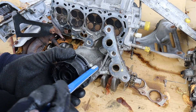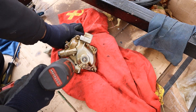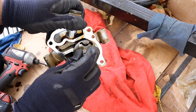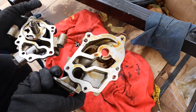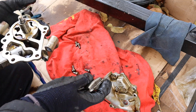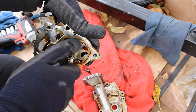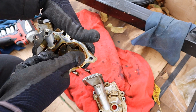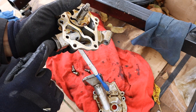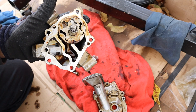This thing is very simple — just oil in and oil out. Here we've got the oil pump. I'll take it apart — it's a bunch of 10 mils. Just a simple gear type oil pump. The way this oil pump works: we've got the pickup tube which brings oil into this compartment, this gear mechanism provides fluid flow as it rotates, and that fluid flows over to the output which goes inside to the block. This here is a fluid pressure regulator — if the fluid pressure exceeds the limit, it's just going to short circuit it back around to the other side.